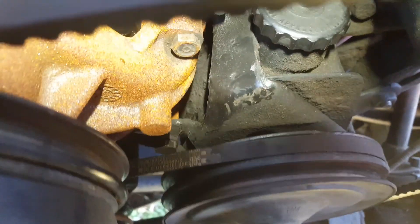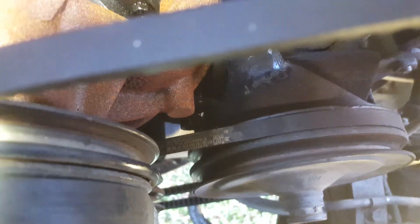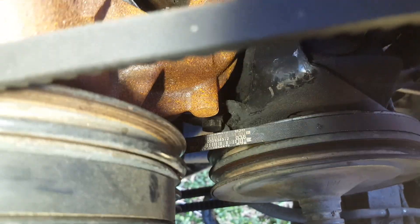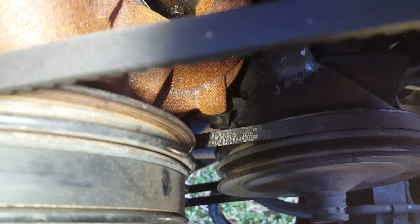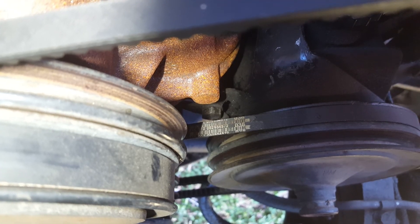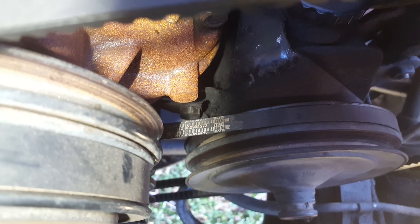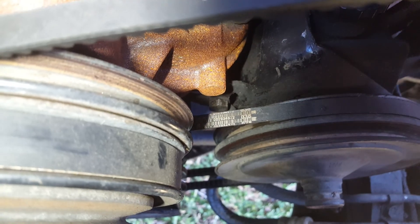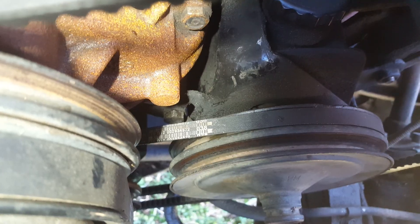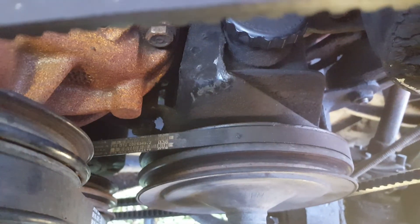Almost forgot this part — if you look straight down past the water pump, you'll see another bolt head right there between the water pump and the power steering belt. It's not exactly a pivot; it's got a slot in that bracket. You can't see it, but that big bracket has a slot — so that's another adjustment slot, tightening slot, whatever you want to call it. That's generally the way this is set up to do your power steering and air conditioning adjustment.